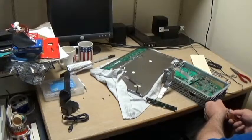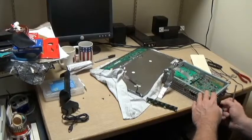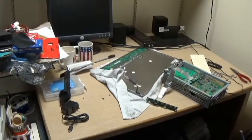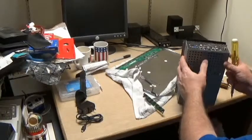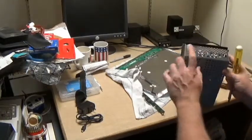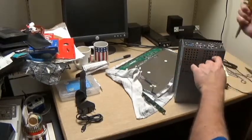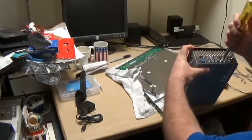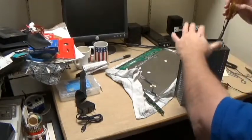I'll tell you what I'm going to do. Since this is kind of slow going, I want to pause recording for the time being. Hang on. Okay, I almost have all these guys in. There's one more left to do. Fine threaded for here and here for the VGA and HDMI. Coarse threaded for just holding the rest of the board in.